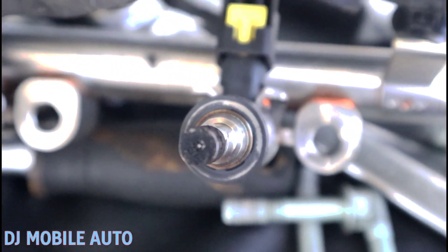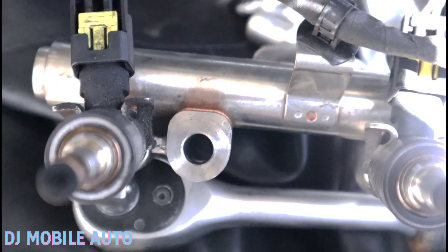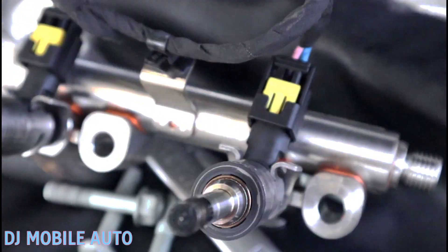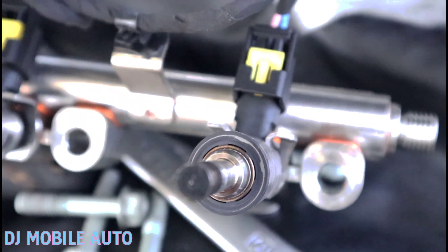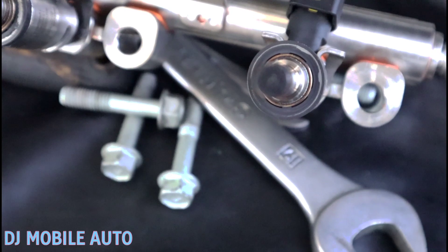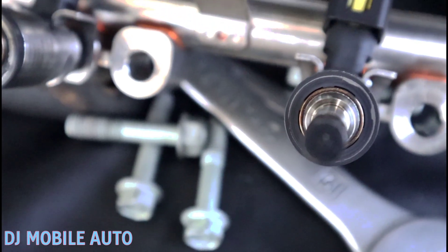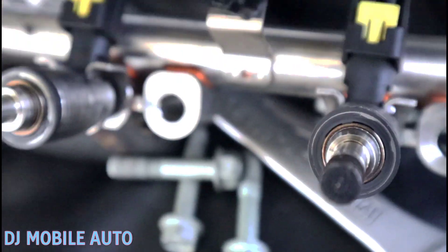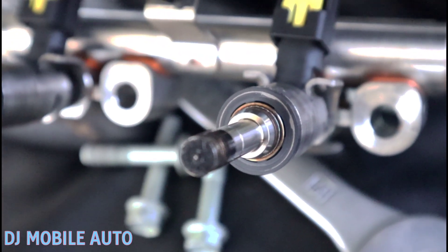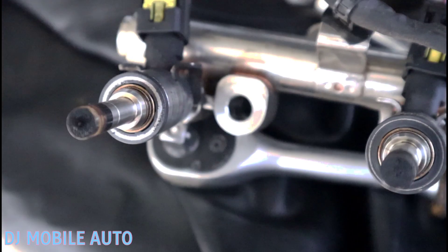Now let's remove the injectors and put them on the injector cleaning machine. You can see the tips are very clogged — you can't even see the tips to be honest, they're very dirty and clogged. That will cause the engine to run lean, and that's where the valves are burning and the car runs rough and doesn't perform like it's supposed to. These are things you need to do periodically. Some guys will look at the price and think they won't pay that much for this treatment, but I'd rather do this than repair your entire engine. I'm going to put these in the ultrasonic bath with cleaner, make sure they're not leaking or dribbling, and make a recommendation to the customer that every so often we need to do this to remove the excessive carbon buildup on the injectors and valves.